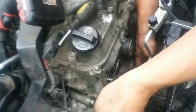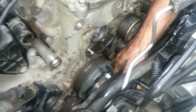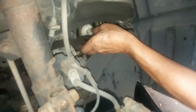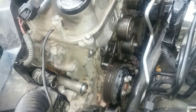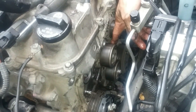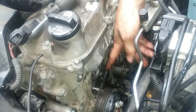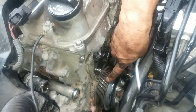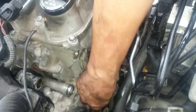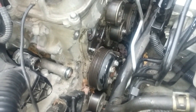So this is the tensioner — the belt tensioner. Let me just take the belt off. I'm going to take these two pulleys off: the tensioner pulley and the idler pulley. I've got to take them off anyway because I won't be able to take the water pump off without those out of the way. Then I'll take the water pump pulley off, and there's another belt guide pulley behind the water pump pulley, so there are four pulleys I've got to take off.